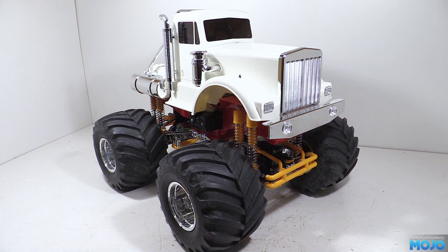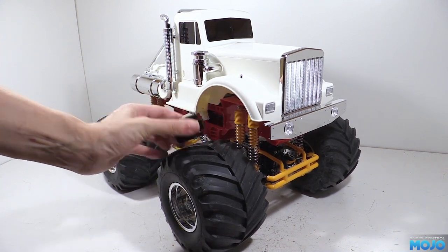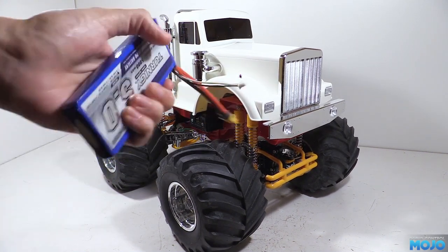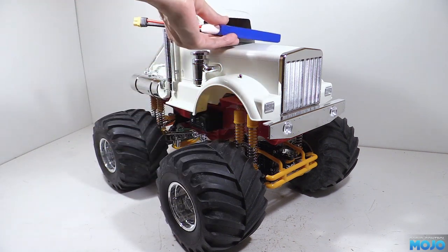The stock chassis is an old design meant for a 6-cell NiCAD pack. They run across the chassis using the end caps to hold it in place. As a system it does work, but it's really not the best looking. Also, modern LiPo packs aren't always a very good fit. So we're going to change around the chassis to fit these 5Ah 2S LiPo packs.